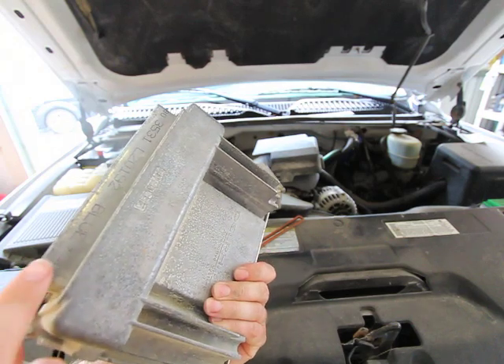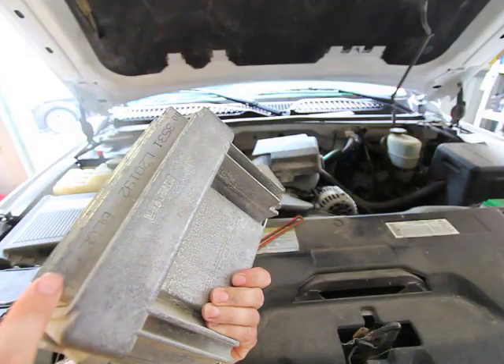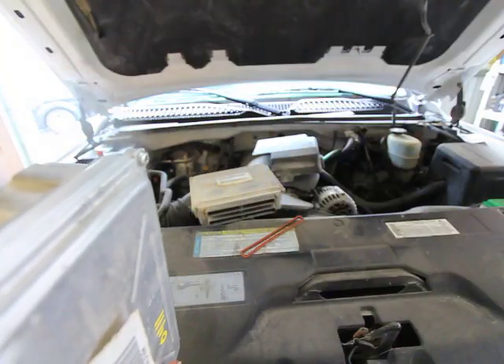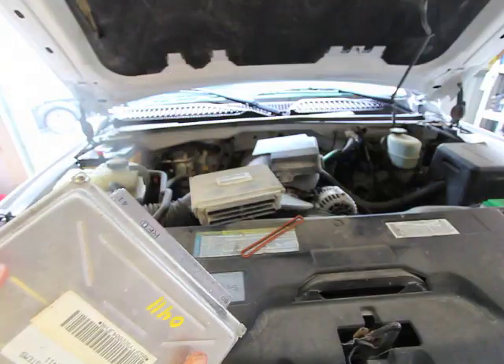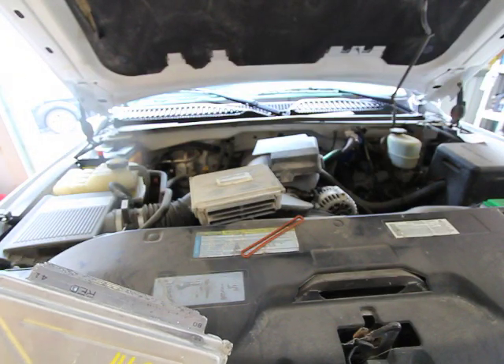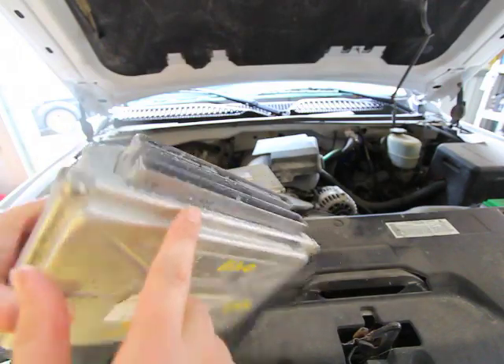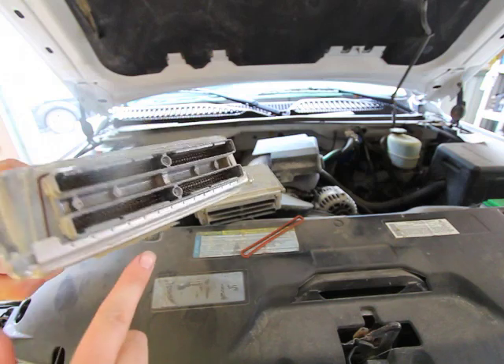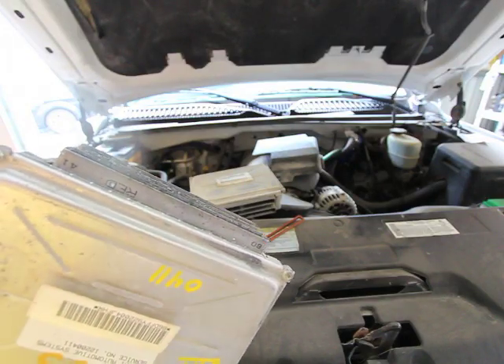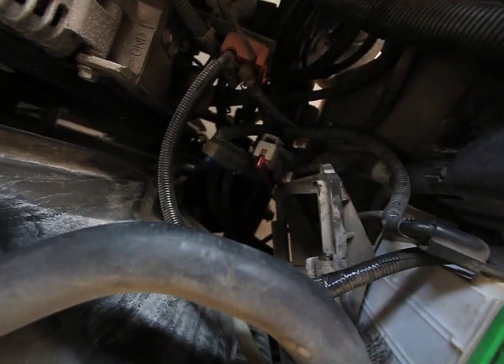On both the replacement and original PCM, the plugs are marked — this is the blue side and this is the red side. When it goes into the holder, it only fits one way, and the way the wiring harness is formed, those plugs are basically only going to be able to go in one way. If you ever need to confirm it, it's marked on the PCM itself. Also, on the connectors themselves there are blue and red — or blue and green — caps that cover and protect the pins, and that's the easiest way to match which side is which.